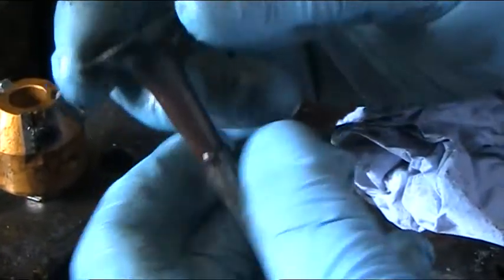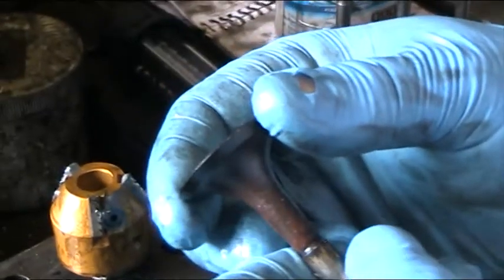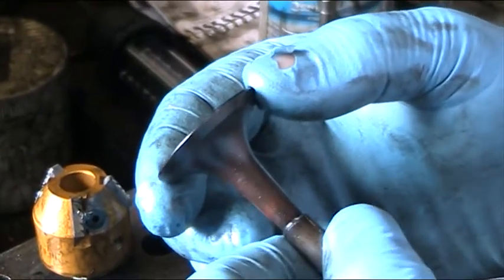So we're going to replace the valves as well, and then we'll give it a vac test. That means we'll seat the valve on the seat, draw all the air out of the ports, and see if it's sealing correctly.